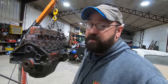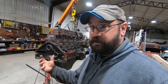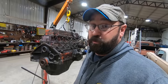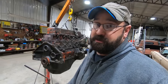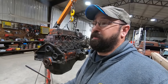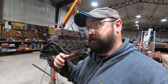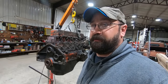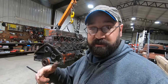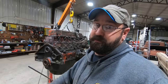So the beauty of these things is you can bolt a small block right up to that bell housing because it's the same bell housing. So if we were to want to change it out or somebody would, you get all kinds of options. You can bolt a big block, small block, LS, whatever you want right up to that transmission. But then it snowballs and you're doing exhaust, you're doing radiator hoses, then you're doing throttle linkage, you're changing the wiring. Then you get more horsepower. It's like, oh, should we upgrade the brakes, power, disc, all that good stuff. Dual reservoir. And then, you know, like, oh, you're doing that? Well, let's get rid of that clunky SM420. Let's put an overdrive in it. You know, you have 5-speed, 6-speed, 700R4, 4L60, or just a plain Jane Powerglide or a Turbo 350, whatever.